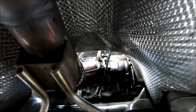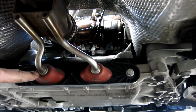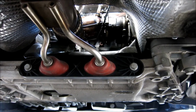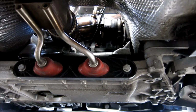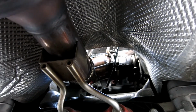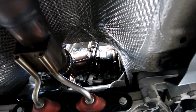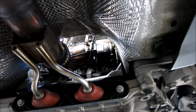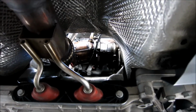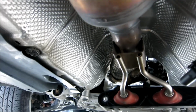So as you can see, those 2 bolts are out at the bottom. You've seen that we have the 2 bolts out at the top. What I'm going to do is, you can either use a pry bar to get these out, or what I'm going to do, which is the easy way, I'm going to just get this thing out of here, and then I'll remove these once this whole piece is out, because then it's all free. So we're just going to remove these. I believe they're 13s. I'm going to check right now. If they're not 13s, then chances are they're 16s. So stay tuned.